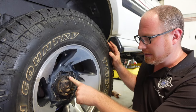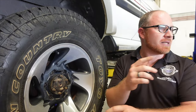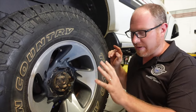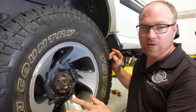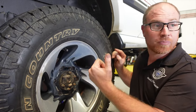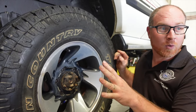These 8mm studs, if they're not damaged, like even in Sooty's here somewhere, even in that, we only run 8mm studs but ARP studs in it. Very, very rarely ever have an issue with it. So the 10mm upgrade is really not necessary at all in our book. It's usually damage from people trying to get that cone to pop out and hammering the outside of the axle. That's just the wrong way to go about it.